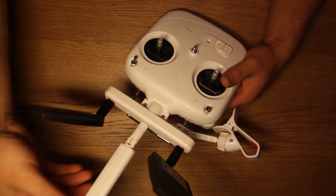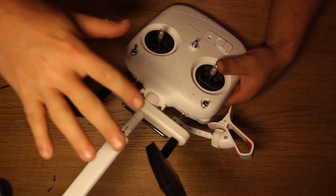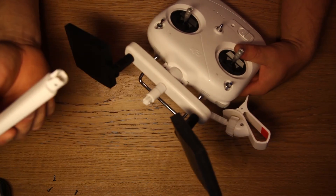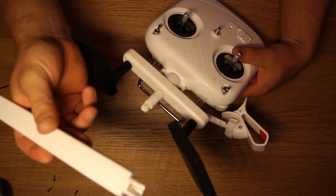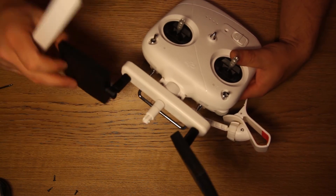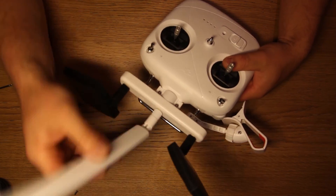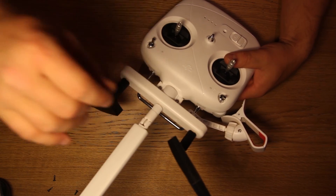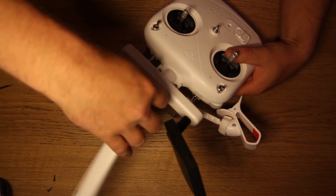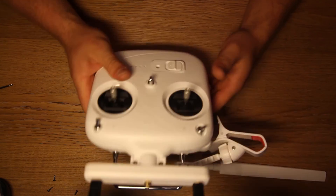As you can see it's quite big with those two new antennas. What happened to me is — because I was too lazy and didn't always take it apart when putting it in the bag — I was just throwing it in the bag, and what happened is the long antenna can break off and get loose. Eventually the cable just snapped. I would strongly suggest: please take this one out when storing it. Those side ones are not so bad, but that long one will just pop off and snap. I've already ordered another one, hopefully arriving in a few days, but I had to put the original antenna back in because I needed to use the drone.